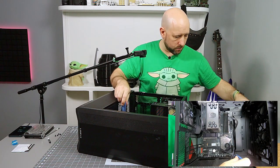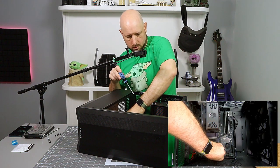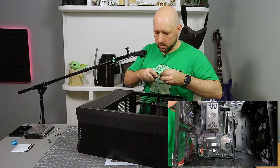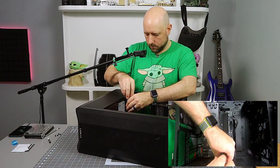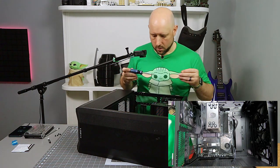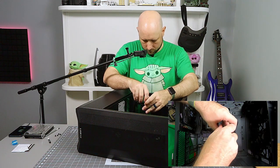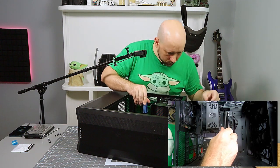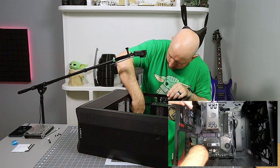Generally, at least in my experience, the screws have come with the case. So if you're opening everything brand new and you're looking in your motherboard box being like, oh, where are all my screws? A motherboard will include screws for M.2, and if you have some kind of specific goofy bracket for vertical mounting or something like that, they may have special screws for that. But usually it's the case that gives you the motherboard screws. This part is not exciting.